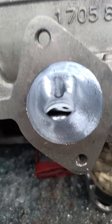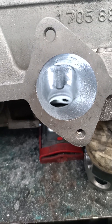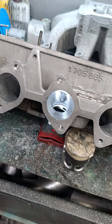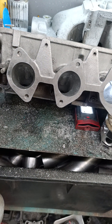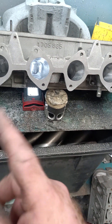This engine can make 230, 240 horsepower — 2.8 litre, 10.2 to 1, nice little cam, head work, extractors — and this one will be pretty too. This one's going on another fully detailed M2 2.8. A little bit of port work is always worth it — it's worth the hours of learning. If you've got a spare head and you want to learn, do one port, take it to a flow bench, get it flowed. Do the next port different, do all six ports different, take it to the flow bench, learn what works, and then add up all the little things that work.